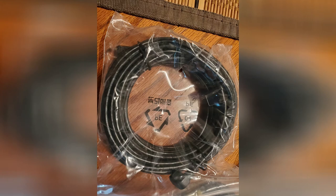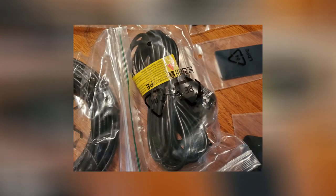This is the cable for the rear camera — the longest cable in the box, because it has to run from the front all the way to the back of the hatch or rear window. This is the cable that goes to your cigarette lighter, so if you don't want to hardwire your dash cam you can just plug it into the cigarette lighter adapter to power the dash cam. However, you will not be able to have parking mode enabled unless your car has a cigarette lighter port that remains powered while the car is turned off.